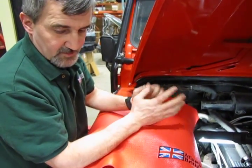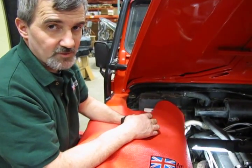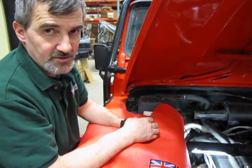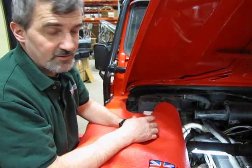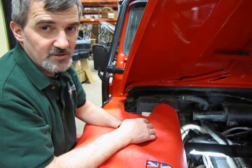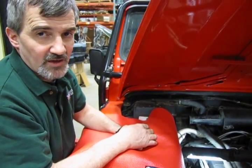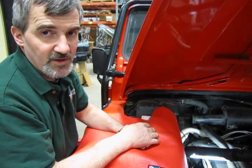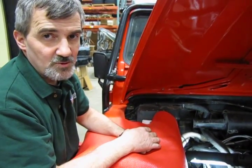As mentioned, it's recommended every 30,000 miles you should change that filter. If you go off-road or are in a dusty area, maybe every 20,000 miles. It's a good idea to check it every other oil change. That's an air filter installation on a D90 with the 4.0 engine. You can call any of our knowledgeable salesmen — they'll be happy to help you out at 1-800-533-2210.